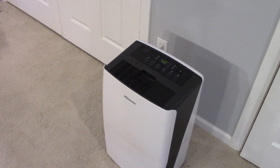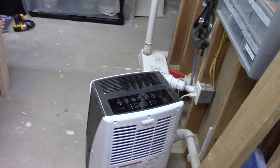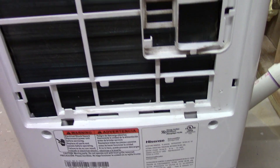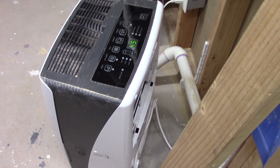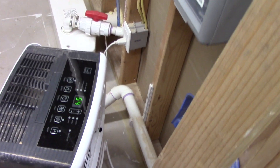So what we're going to do now is go back to the original dehumidifier and I'll show you what I'm talking about. Unlike the 2010 Kenmore that he had, this is still all together so I can turn it on and show you. We'll take off the back compartment here, which is where the filter is — you can see the filter's clean, it has nothing to do with that. And here's the evaporator coil. The ice tends to build up a little bit on the bottom here. On the replacement, the blower wheel looks more balanced — again, I don't think that's really going to mean anything.